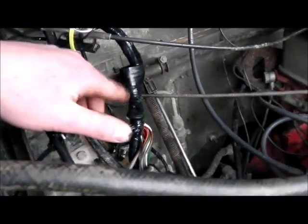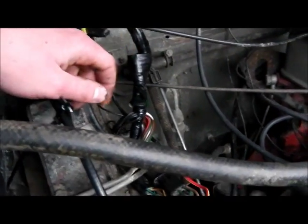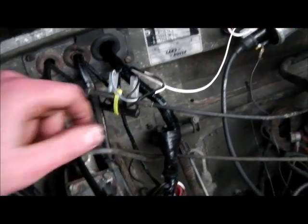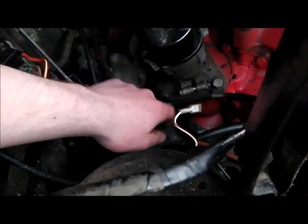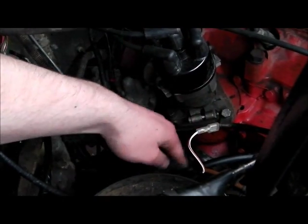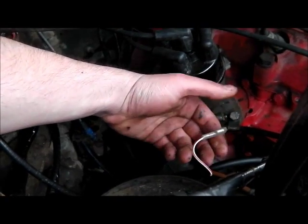I've got an extra plug there for the kit that my Land Rover hasn't got, so I've strapped it all up and insulated it. There's a choke warning light there and that's the stop switch for the brakes. Put the battery tray back. Also, someone's run a separate line to the starter solenoid which is down there — that goes to the relay in the centre console. But I might be able to bypass that, so I'm going to get it running with that, and then once I know that works I'll try this line, which I think is the right one.